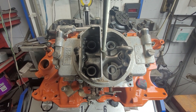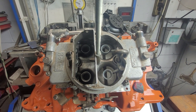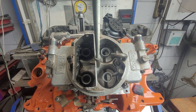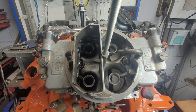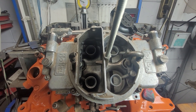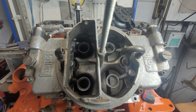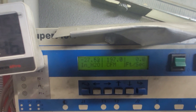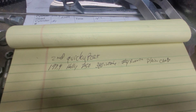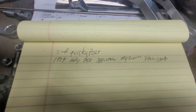We got a couple of questions and suggestions on what to test. This is still bolted to the bench from the other night, so we're going to get a baseline with this big Holley — I think this is an 850 — just the way it is, and then throw a couple other things on it and see if the airflow changes. I don't believe we got enough flow through this cylinder head to make much of a difference, but it'll be interesting to try. Okay, 197.4 — reason I'm retesting it is because it's a different day, so it's only off a touch from where it was.